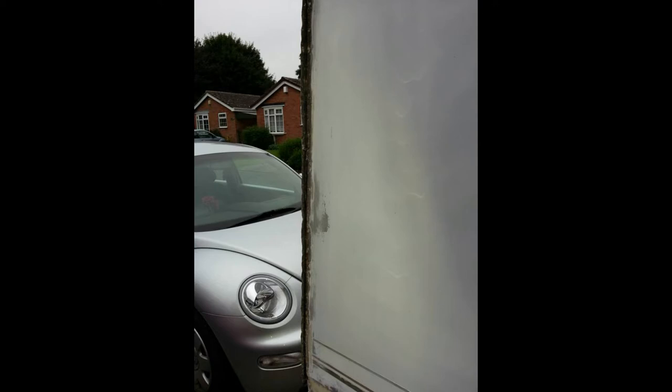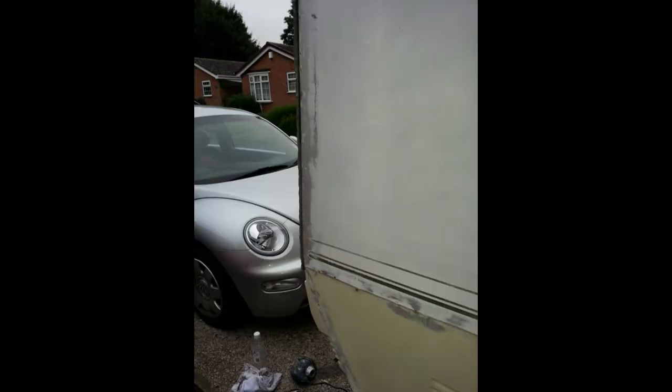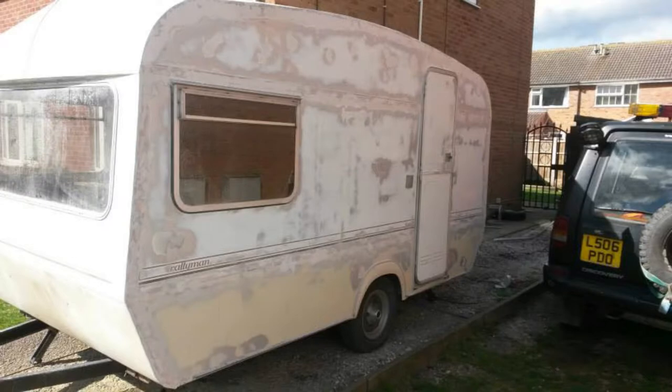All the edge trims including the awning rails were taken off. Then I peeled the skin back — the skin was folded over — so I peeled it back and cleaned away all the old sealant, getting back to bare aluminium. Then Sikaflex'd it back before folding it back for the Sikaflex to bond and seal it all up. Then I went over it with fibreglass filler to give it a really good seal — all the edges folded back, cleaned, Sikaflex'd, and then fibreglass-filled over the top once bonded back in place.